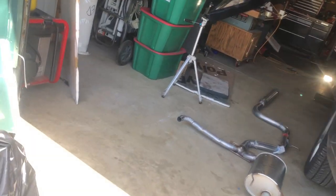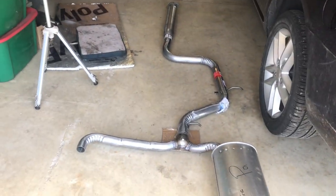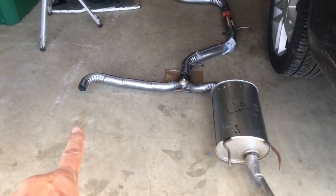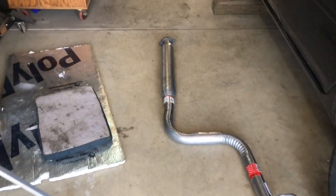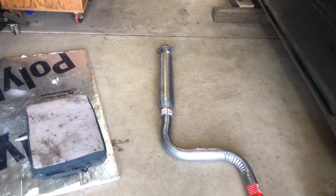Today what we're going to do is give her a cat-back exhaust. One of the mufflers is already on — I'll have to take the muffler off; it's just clamped on so it'll be fine. Over here we've got the rest of the system, and this is all by Walker. We've got the passenger side muffler, the driver side muffler I'll pull off from under the car, the intermediate pipe and the resonator — basically everything from the catalytic converter back.